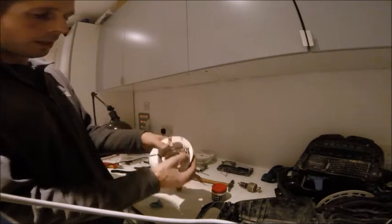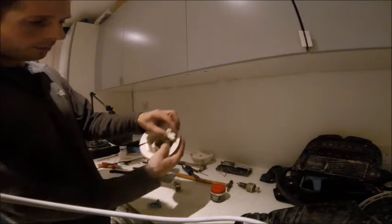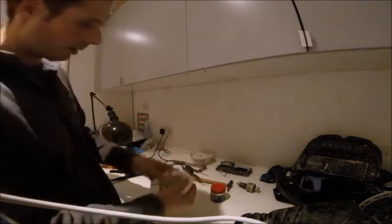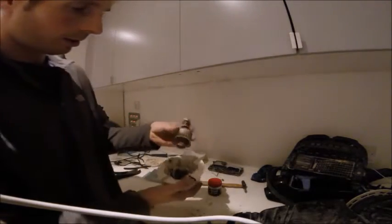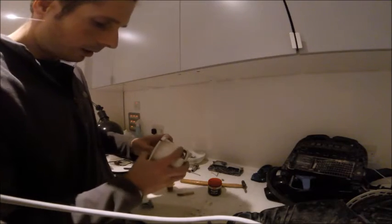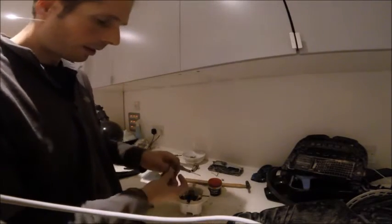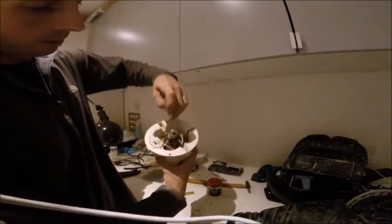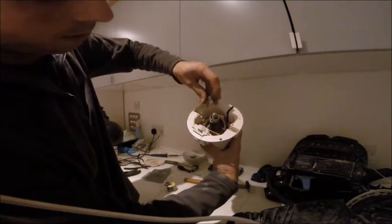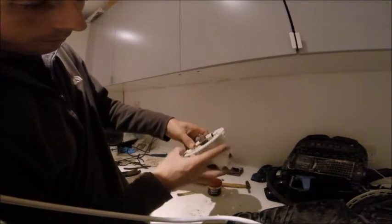Now we need to put the motor back into the casing, making sure it's the right way up so that the piece the brushes hit is at the top. Push that in and make sure it's down at the bottom. The brushes have a little connector on the bottom that goes into a connector on the motor, so you need to compress the spring and pop the brushes in. The brushes are not directional — they're both identical. Pop one down in so it makes a good connection, then get the other one and pop it down in exactly the same way.